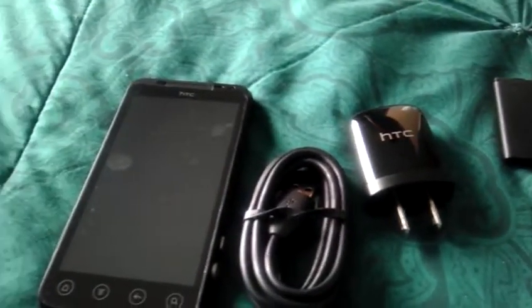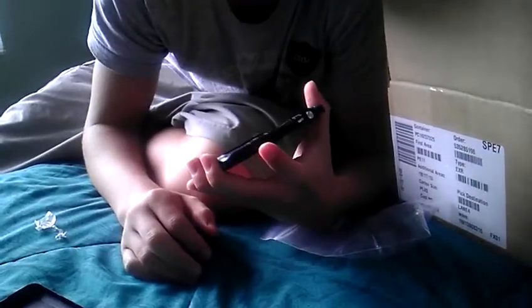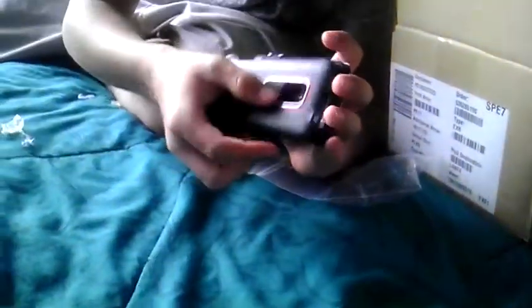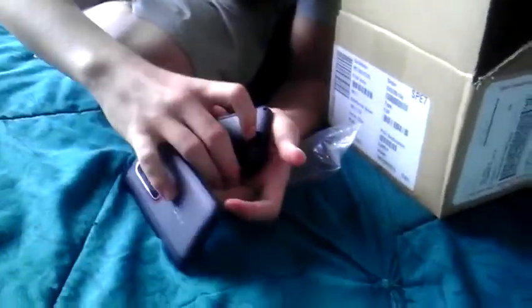That's what you get in the box of your refurbished phone. Now let's open this phone up and put the battery in. It did not come with an SD card, but you can just keep your SD card from your other phone. You put your battery in there, take this cover, snap it in place, and then it's very easy to switch your phone. You just look at the serial code behind the battery — the numbers right there — and then it activates by itself.